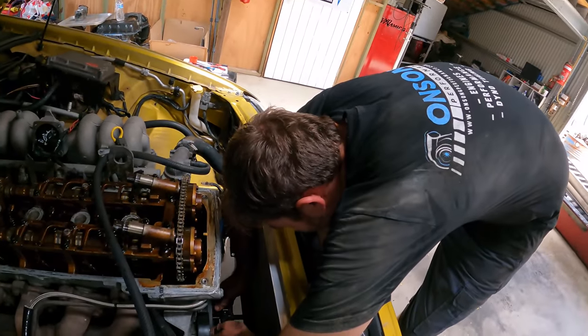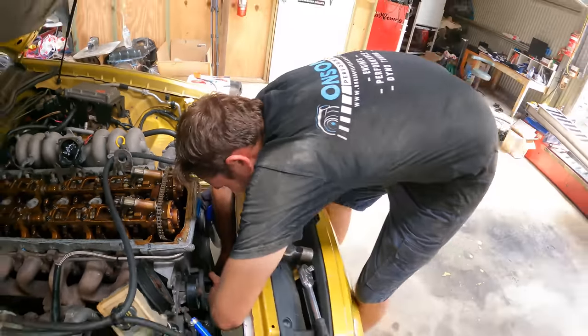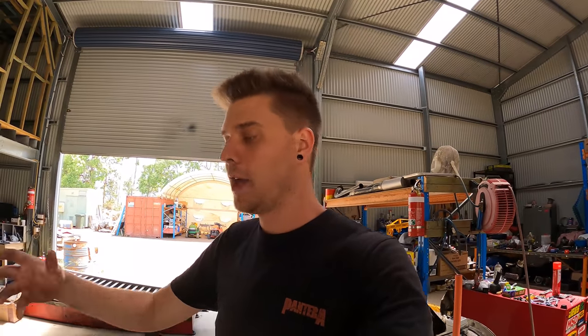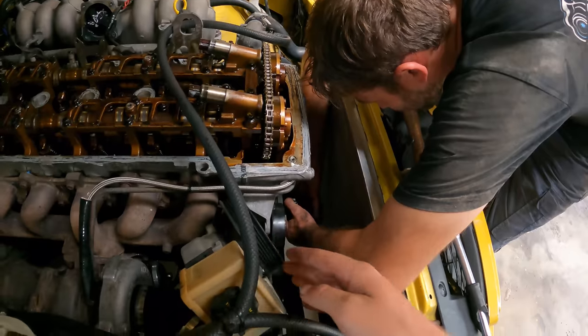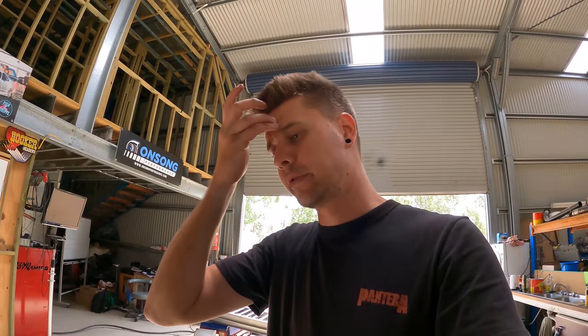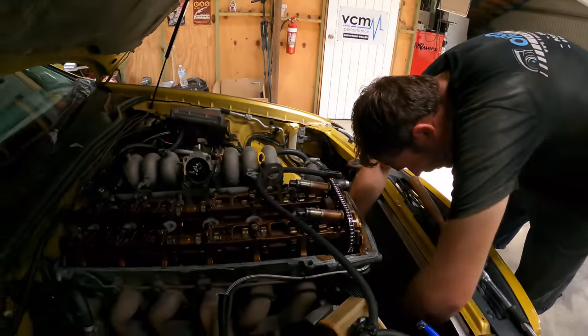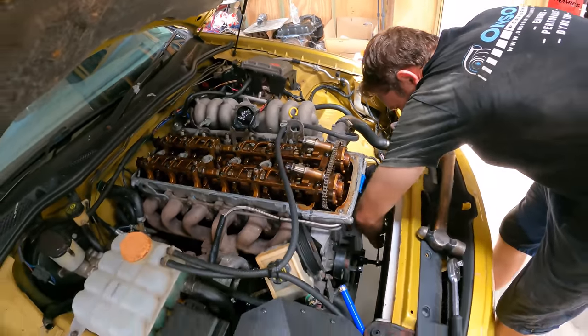The balancer puller just fits in front of the radiator with just enough room to pull the balancer off without removing it. Once the balancer is off and you remove the idlers and tensioner, you can pull the front cover off. You also have to remove the power steering pump and there's a bracket on the alternator that has to move. On BA/BF you've got to pull the throttle body off to slide the cover back over the VCT solenoids. With FGs you can pull the VCT solenoids out without the cover, so it's a bit nicer. That's all step one.